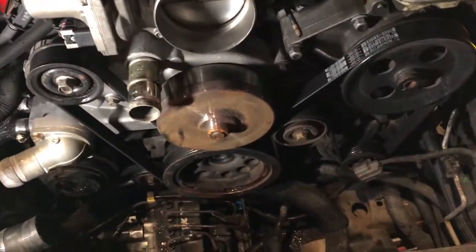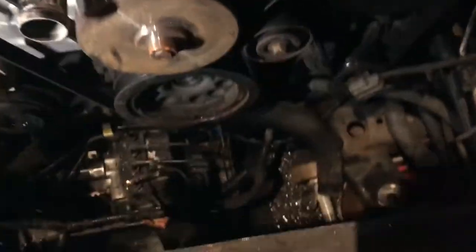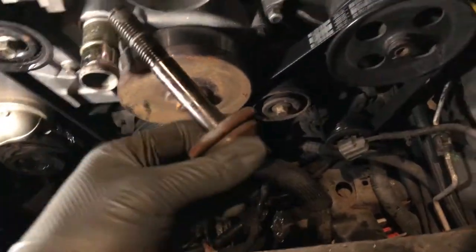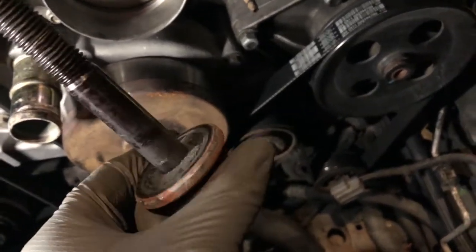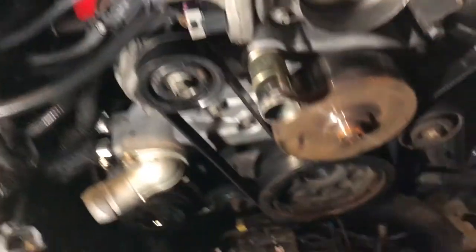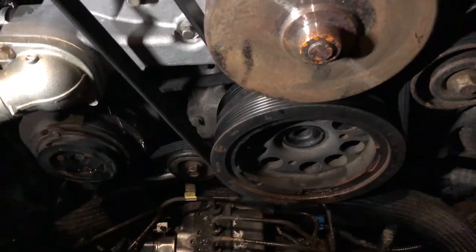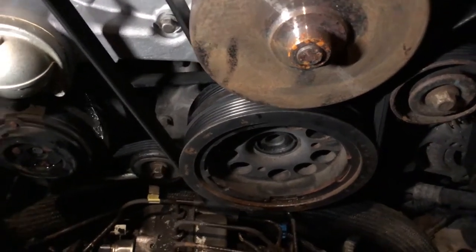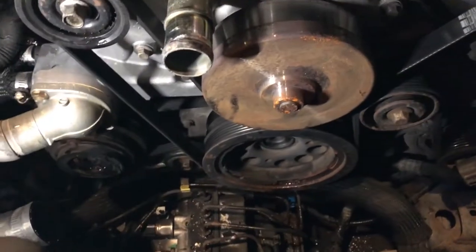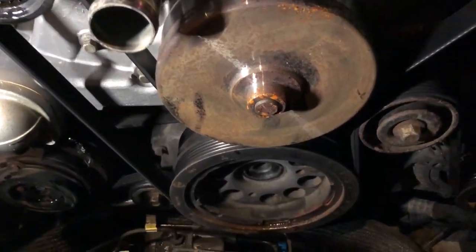I got the rad out, and then the next move was the crank pulley. I had to use the impact gun — the air gun right there. Thankfully I got that because it's kind of a tight fit, even with the AC condenser down there pushed away. I pulled the ARP crank pulley bolt out. I guess that ARP black finish doesn't hold up over the years being on the front of a daily-driven engine, but that guy is out. That leaves my Power Bond crank pulley down there. What I can do now is take the belts off and get that pulley pulled out with a puller — I think a three-jaw puller might be the only kind I have, so I'm going to look at the different pullers I have and go from there.